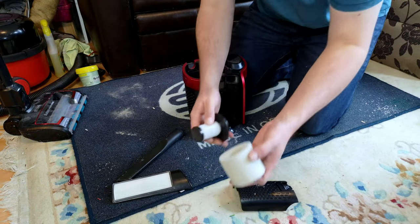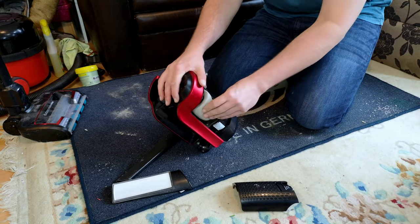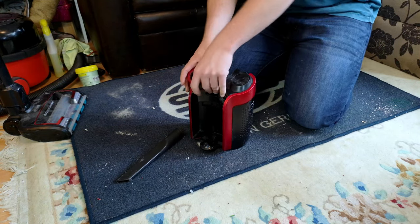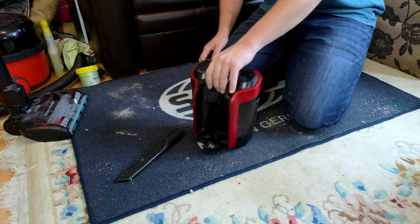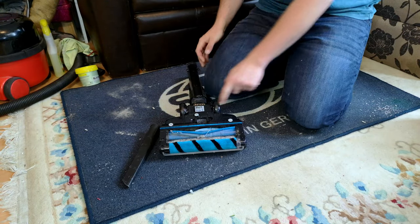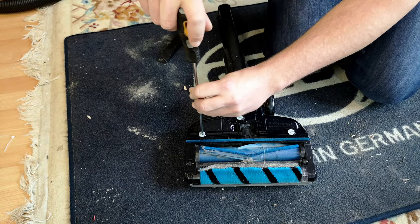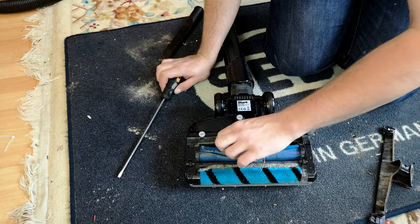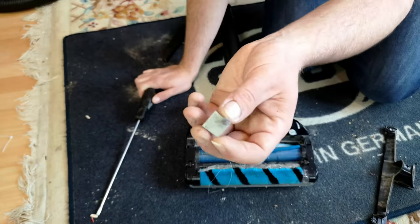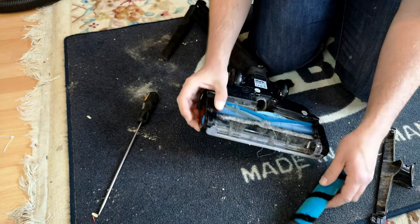Fantastic — there we go. This is really just so that we can try it out in a second and see if that error 6 at least disappears. Then it'll all come apart for a good wash — I'll wash the filters, get everything cleaned and tidy. I just need to troubleshoot it a little bit first. Now let's find some tools to take apart this brush roll and clean out its gunk. These end caps have never been turned — and oh look, there is a piece of LEGO here! The lady did say she thought there was a piece in there, and I think there was a piece in the wand too that we dislodged by putting it on boost.